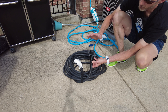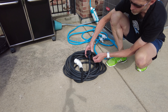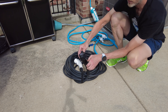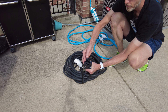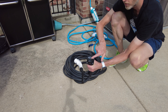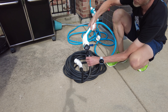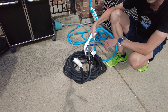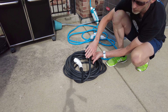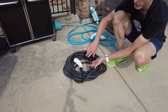The other side is very well built and very sturdy. It does have these bolts that hang out, which I'm not in love with — I wish they'd clean that up a little bit. It's pretty easy to catch a finger or something else on them because they stick out. There's a cap on here that locks to keep water out. This is noted as being rated for 40 amps. This is where you plug the charge gun from the EVSE in — it just clicks in there like you would if you're plugging straight into the car. There's a boot here that connects the female part of the cord to the cable and helps keep everything nicely sealed up.